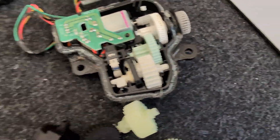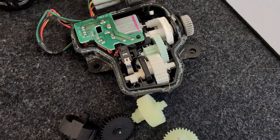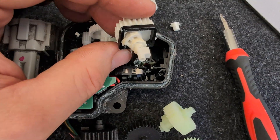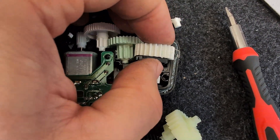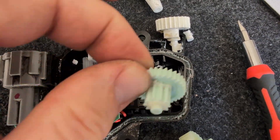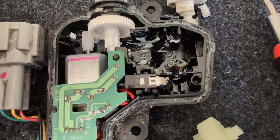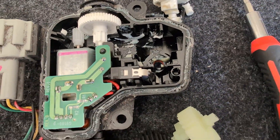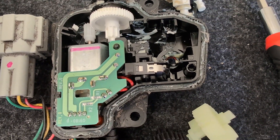All you have to do is replace the gears. Add a little bit of PTFE silicone grease. It's quite straightforward. This is the tab that goes in and locks the cable — just pull it out. This is the gear; it's quite easy to remove. Replace the gears, put it all back in, then reseal with silicone or use heat again to close the unit.